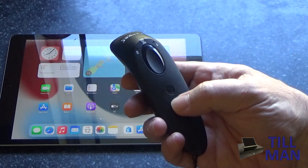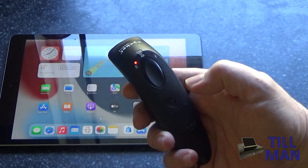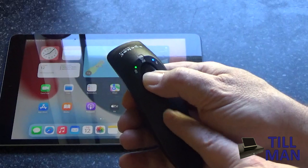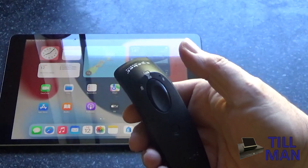The way to fix that is to turn the scanner on with the small button — hold that down until it makes the beepy noise. Then hold the big button like you're scanning something, and while holding that down, also press the power button. It'll do a beep beep beep sound.